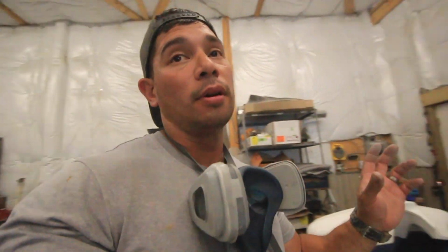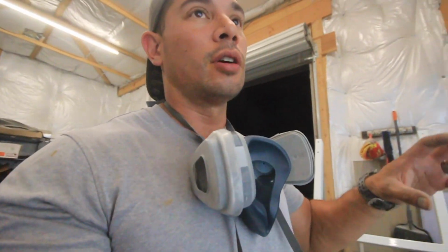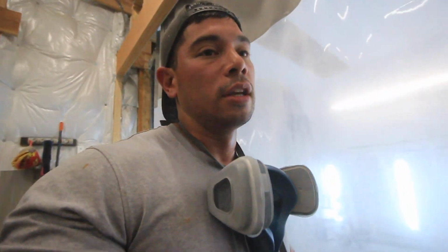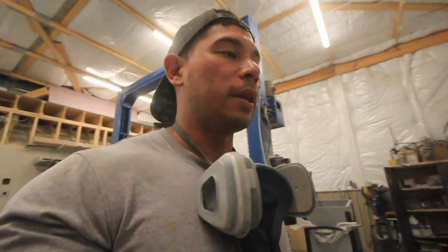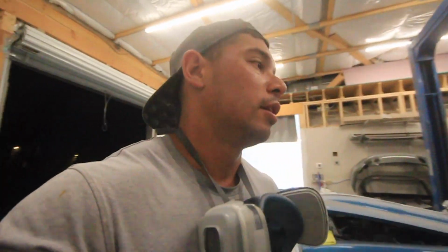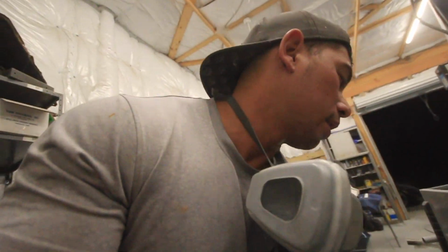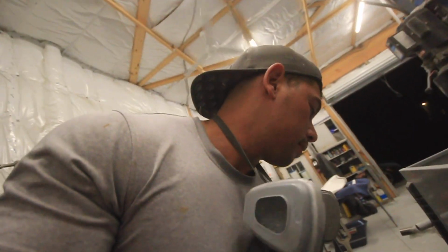What I'm gonna do is I'm gonna prime this and I'm gonna pre-bake it. When I get to work, I'm gonna pre-bake it so it hardens up really, really good. And then I'm gonna buzz it down and shoot it. If I don't see any cracks coming through with the pre-bake, then I know I'm good to bake it after it's painted. Now, it might shrink a little bit more as time goes on, sitting in the sun, but we'll just deal with that then. So, try to get this part on the road.